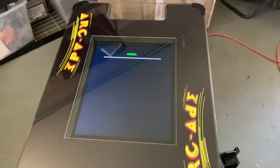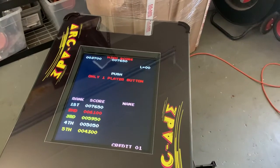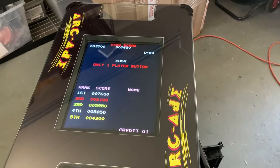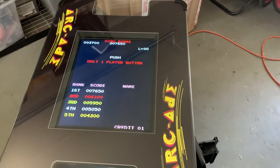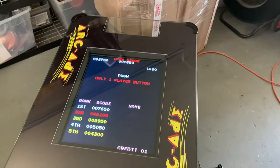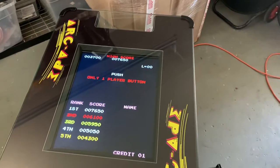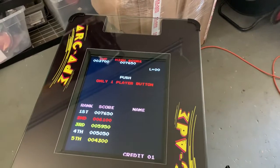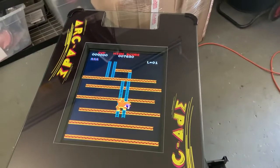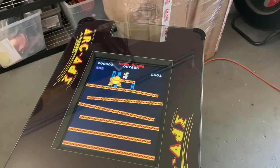To enter a game, simply press the one player start button. I've set this board up in advance to be on free play mode, but you can make it coin operated mode. There are quite a few changes you can make in the settings — you can increase the difficulty level and increase the number of lives per credit. On the side of the board there's a little button: when you turn the cabinet on, press that button while it says initializing and is counting on the screen — that's how you go into the test menu. I've turned the volume down just because it's loud, but here's an idea of what the gameplay looks like.